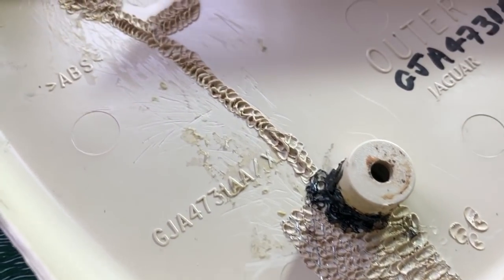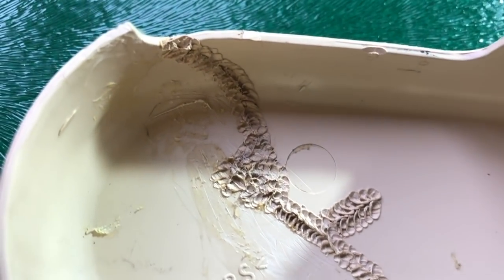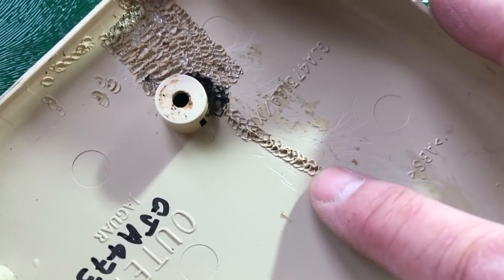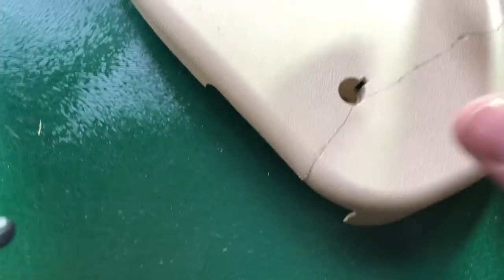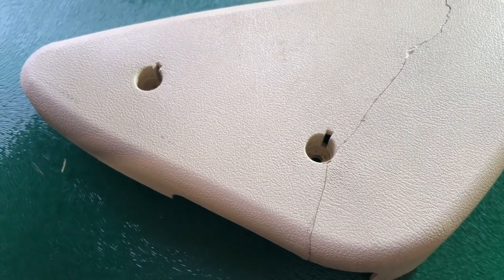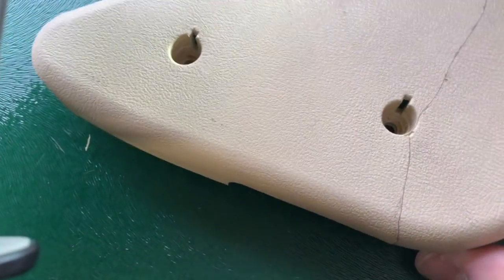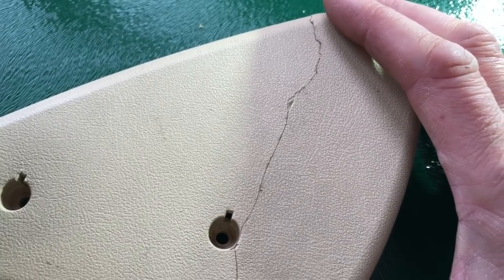Okay, so I finished it off with the first technique, the plastic stitch. Not pretty, but strong enough to make this a robust part that I can now stick back on my part, knowing that it's not going to fall apart. It does have to be thermoplastic that you're using when you're doing this technique, so a plastic that will melt and can be reformed time and time again.